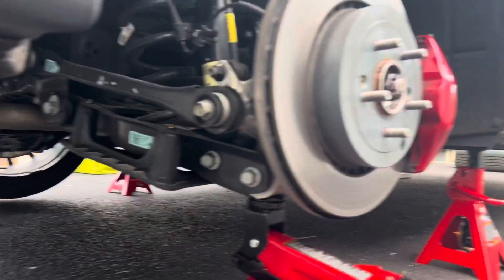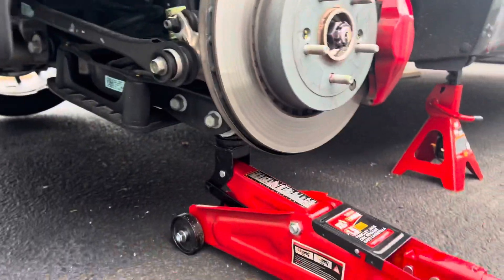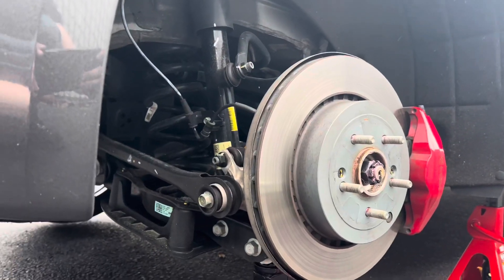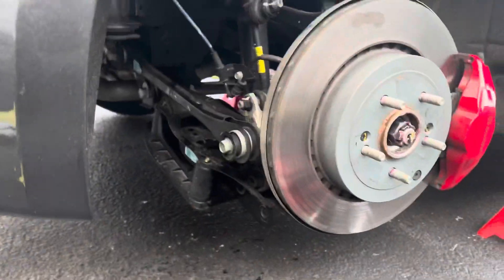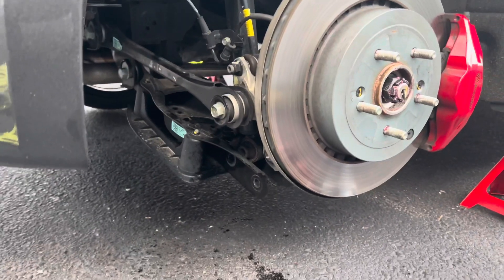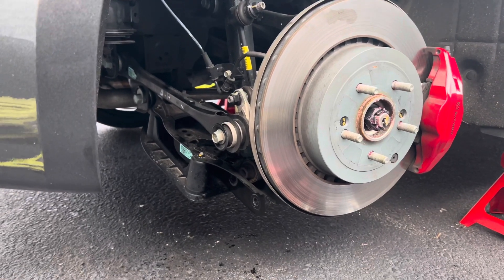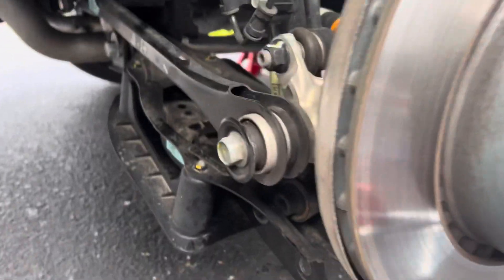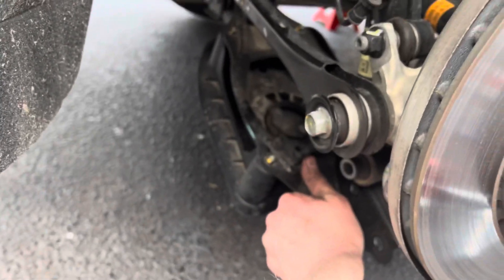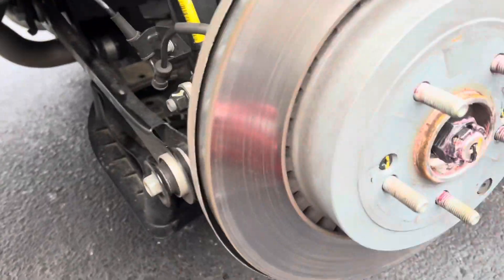The fronts are done — the hard part is finished. The rears are much easier. It's just those two bolts. Support the lower control arm with a jack, loosen the bolts — hold the other end so the bolt comes out cleanly, or pull it as you loosen to help it suck out. Once the two bolts are loose, the rear shock drops, the spring releases, and the lower control arm drops. I laid on my back, kicked it down with my foot, and the spring comes right out. Put the new one in and you're done.